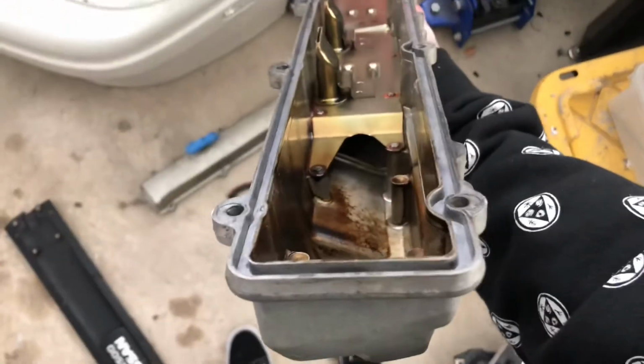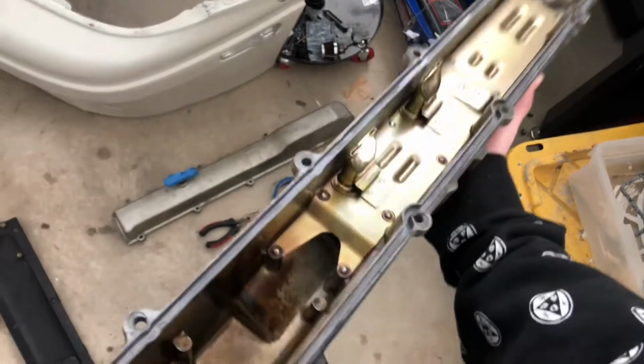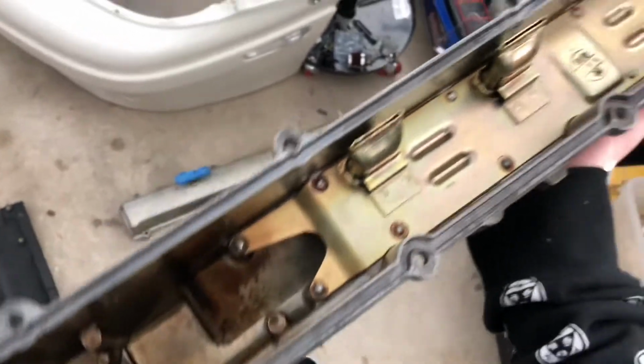And I know you're gonna say, just wash it out and wait for it to dry. I have a friend who's building his SR. He powder coated his valve covers and he washed them out 7 times. Then he ended up drilling out all the baffles just to be sure that it's all clean. And what do you know, the thing was still full of powder.